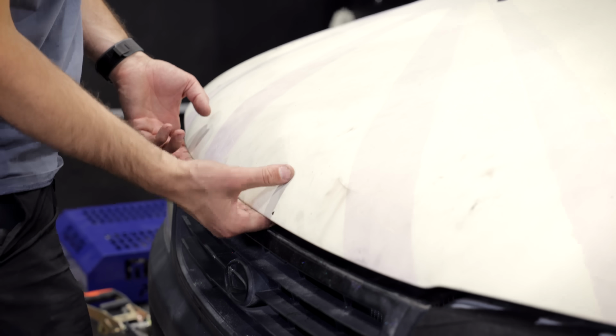It did occur to me as I was coming here today, it's like a stock airbox, maybe it's gonna hold us back. But I didn't wanna mess with the cold air system to potentially lose power. I'd rather know what it makes now and then make changes. So to do that in a cheater mode, we're just gonna lift the bonnet and see if all that extra airflow helps. Then we can try removing snorkels and messing around the intake a little bit more to see what happens. But what definitely doesn't work is just a pod filter slapped on the top of it, because then you make your problems even worse than the factory one.